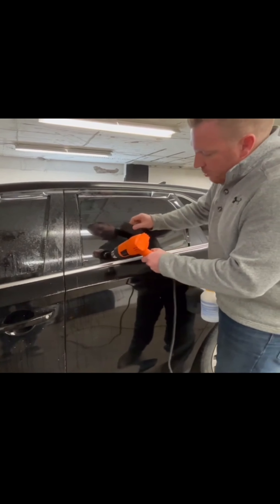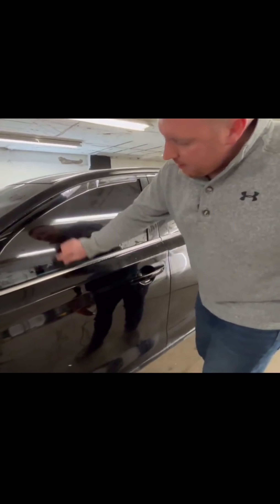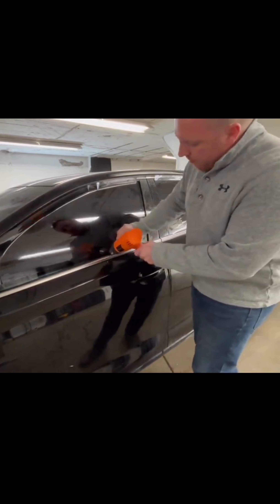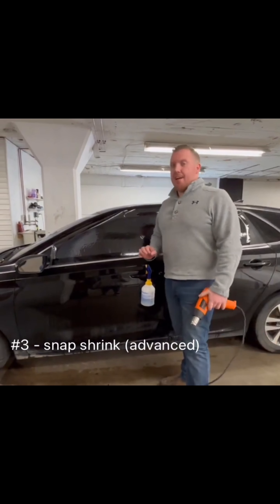You can see here the fingers that popped up. If I were to install without shrinking, I'd get these fingers in my install. We want you to shrink every window. If you don't get fingers, we can add a little tension to the film. I'll do my hard tack across the top, add a little tension inward to drive the fingers up, then block that in and do a light squeegee. The finger needs to go straight vertical up — if it's on a 45-degree angle, pressing down will crease and damage the film.